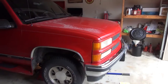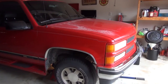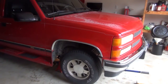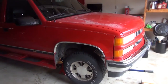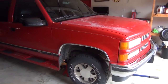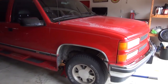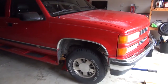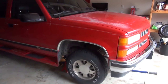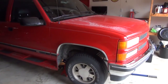So when I got the truck, I don't really have any records since it's a used vehicle. When the transmission fluid was changed, if it was changed at all, it's 114,000 miles. So let's do a fluid change and filter change on the transmission. Anyway, it's a good time to do it. And who knows, it might actually behave a little bit better through its shifting pattern, or not be quite so fussy, at least not on the overdrive gear.